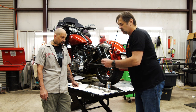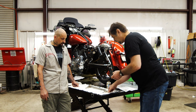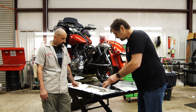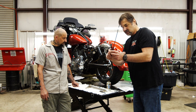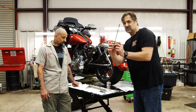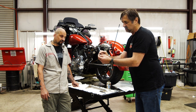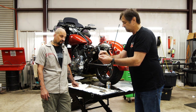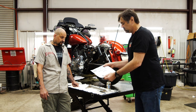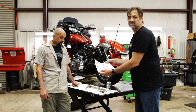We also include a transfer punch for spotting the back of the swing arm to give the adjuster screw a place to register so it doesn't rotate, and a special 45-degree drill bit. It's a short bit for clearance and the point is actually 45 degrees — not your average drill bit. We're going to drill just to that point; that's all you need. Full instructions are included — comprehensive, they make sense, not translated from Chinese.